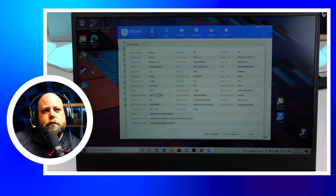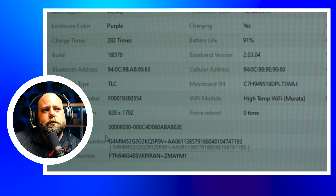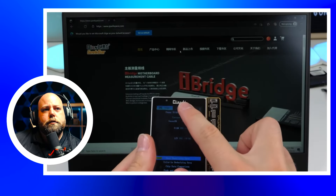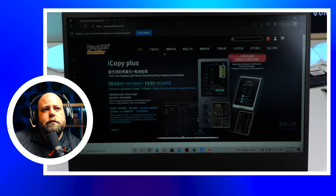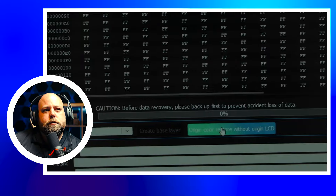My goal is to revive the serial number without the old screen. This iPhone 11 does not have True Tone, as the screen was changed without reprogramming it. We first have to retrieve the serial number. We can do so by connecting the phone to 3U Tools and clicking on 'View iDevice Details,' which shows us the serial number. We're looking for the cover board number, and clicking on it automatically copies the serial number.